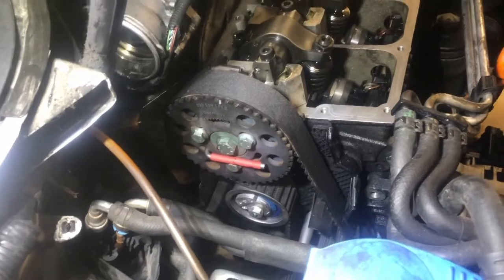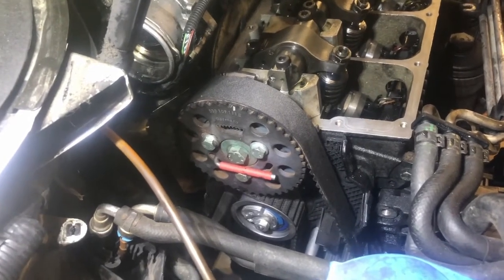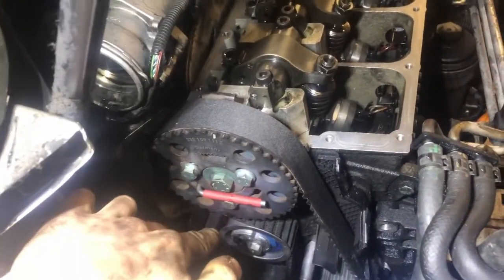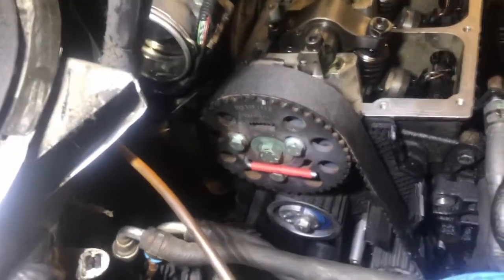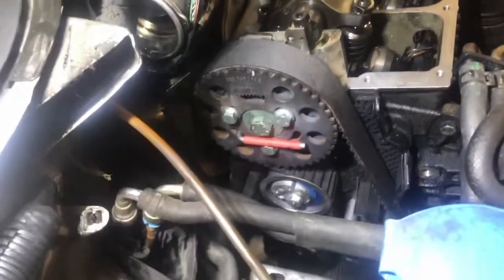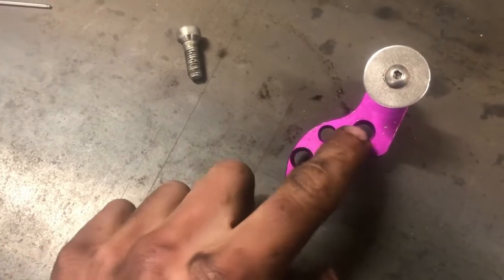Here's the cam lock with the tool. If you're doing the timing belt with the correct tools, it doesn't really matter whether you lock the cam first or the crank, but you're going to have to loosen off these three bolts and rock the cam gear one way or the other to get both tools locked in at the same time. I've got a metal nerd kit here with four sets of holes - two threaded ones and two with tapers, which are the ones you use on the car.